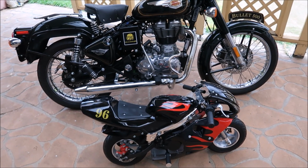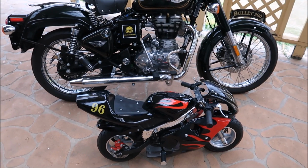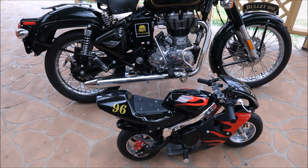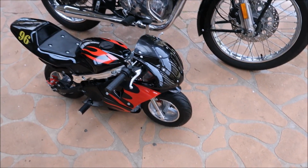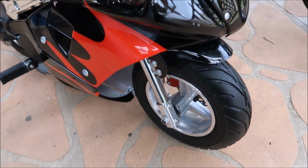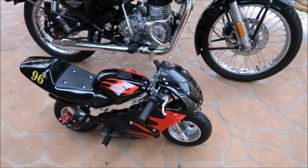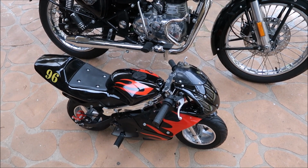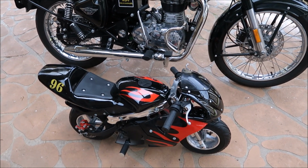Okay guys, that concludes part 1 of building this little mini bike, and I'd have to say, in all seriousness now, it really was a bit of a pain in the tail to put together. I had a fair lot of trouble putting on the front wheel, fitting the spacer and actually getting it in, and the front axle, almost like it was extremely tight fitting, even though a greasy axle, and the other parts of that area to slide that wheel in. In the end, it took a rubber hammer to belt it through.